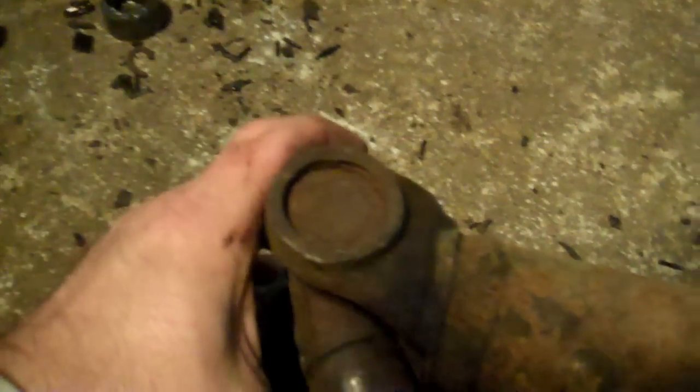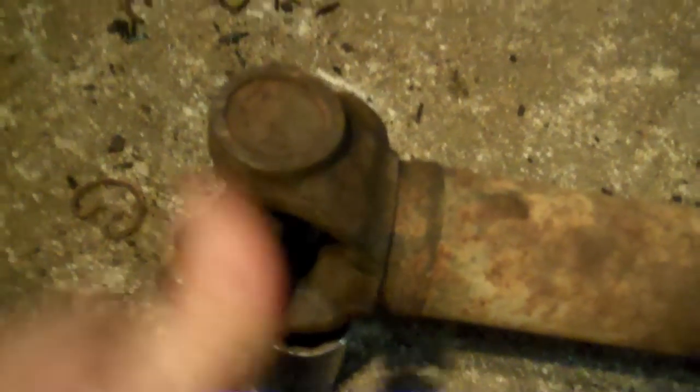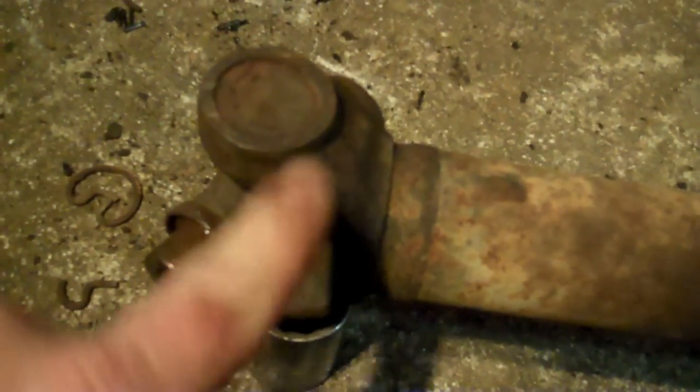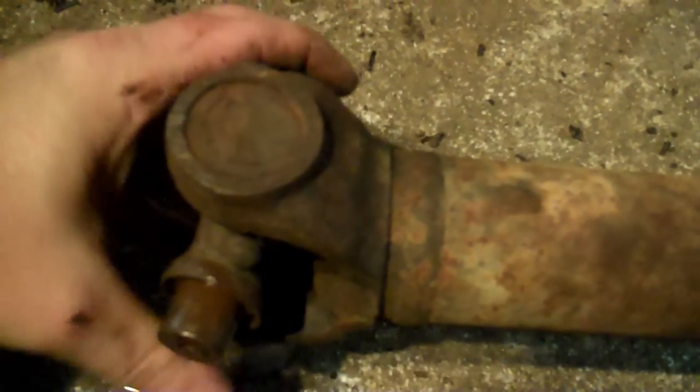This is the wrong side to drive through — remember the grease fitting? There's the grease fitting. If you drive it up this way, the grease fitting will bottom out on the yoke and you won't be able to get the cap off. So don't drive it down that way. On with the rest of the video.